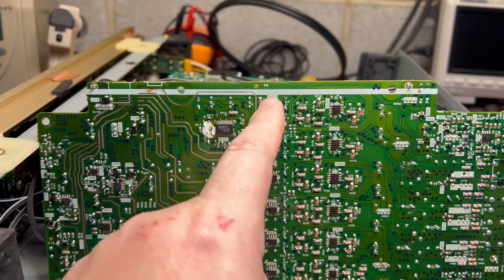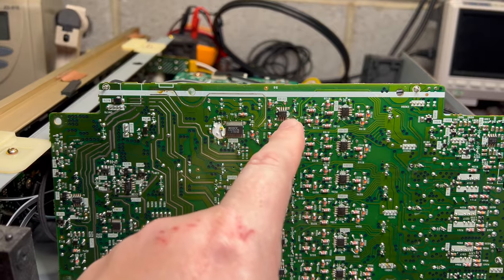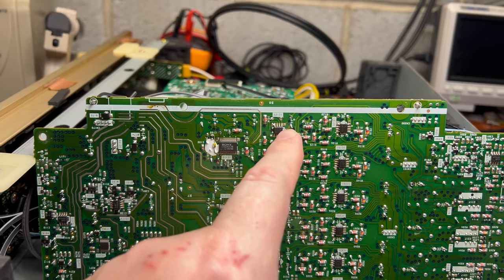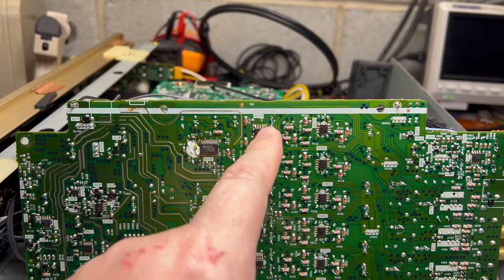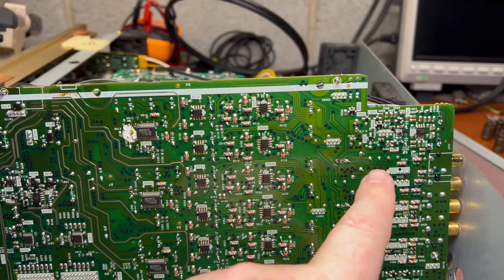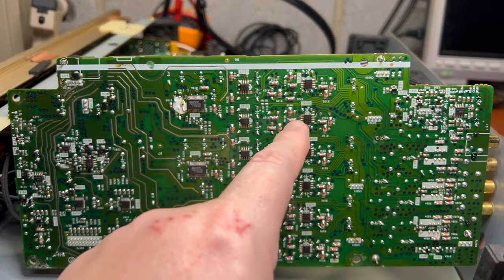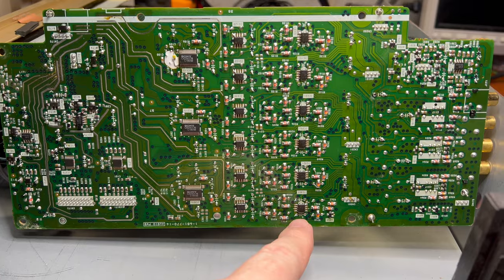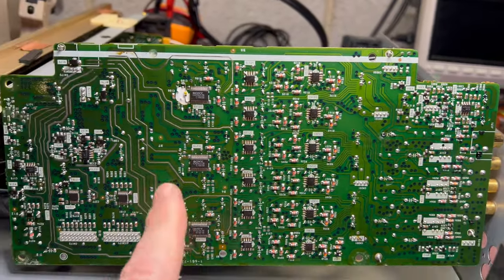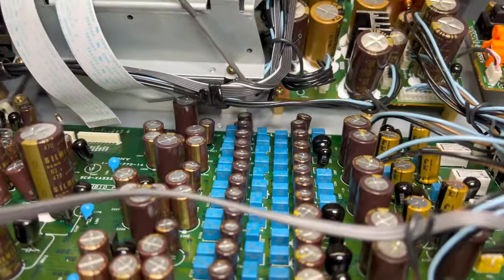And then for each output, there is a double op amp which converts current into voltage, and then these 2 voltages, positive and negative, go to the differential op amp and then go to the output through a capacitor. And this for each channel, so we have 1, 2, 3, 4, 5, 6 channels, and they're similar. And on this side you may see just resistors, transistors, microchips.